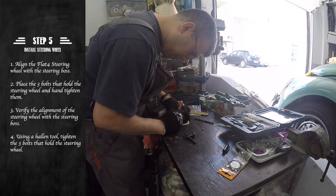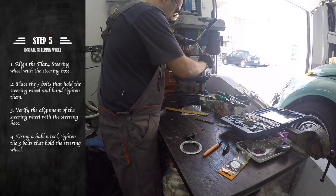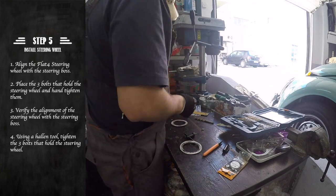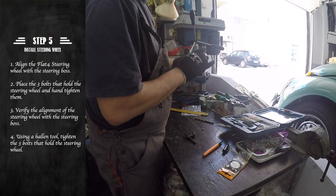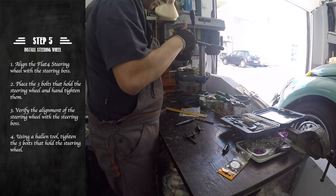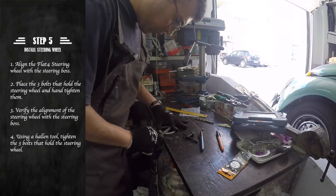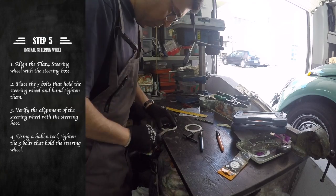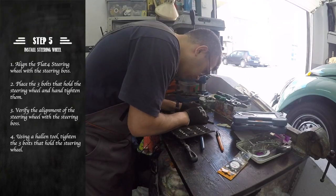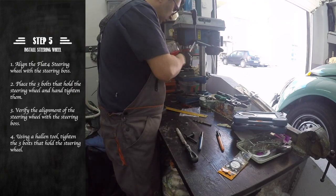On the bottom ring, we will start by drilling the 6 holes using a 3.5mm drill bit. The next step is to enlarge the 3 even holes with the 4.5mm drill bit.